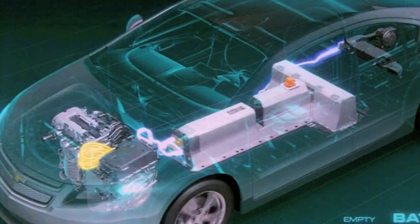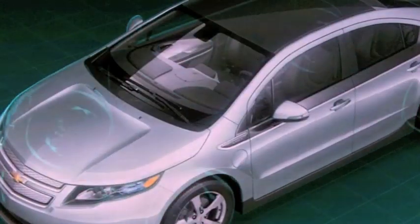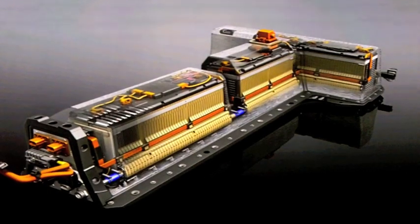When the battery is down to our minimum SOC, where we've maintained our buffer, we go to extended range mode. The engine has started — it's now driving the generator, which powers the electronics, and the battery basically acts as a large buffer during driving. When you tip in, the engine is not capable of producing 110 kilowatts, so the battery provides that difference. When you come to a cruise, the engine is able to make that up with the generator — some goes to the wheels, the remainder goes back to the battery. The battery floats in a small SOC range at the lower end, always providing that peak power during acceleration. The generator, motor generator, and battery are working together very closely — it's really one of our key enablers, a very unique feature that no other EV can really provide.